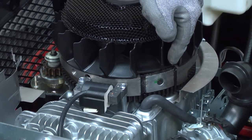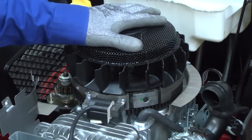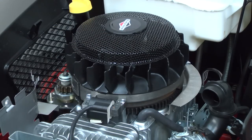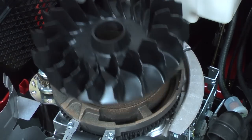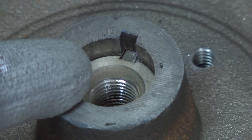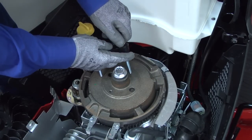Here's how the timing works on a riding mower engine. The flywheel magnet and ignition coil control spark timing. When the flywheel magnet passes the ignition coil, the coil generates and sends current to the spark plug, causing the spark. The flywheel key keeps the flywheel aligned on the engine crankshaft so the magnet passes the ignition coil at the right time. The flywheel key is a small metal rectangle that keeps the crankshaft and flywheel aligned when you tighten the flywheel bolt.